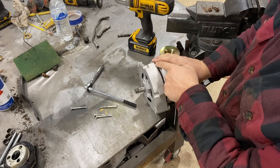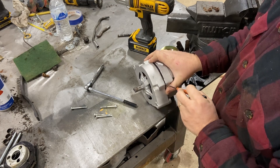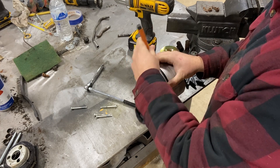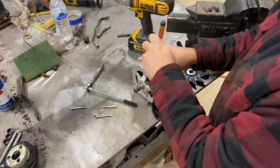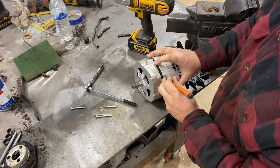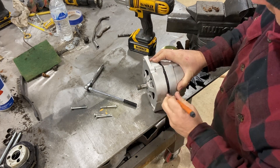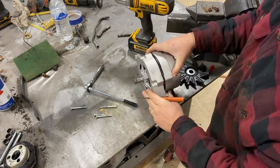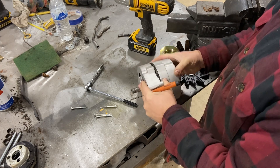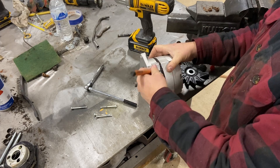So what you do is you take a screwdriver and the thin little black line that's in between — you want to pry on the front side of the black line. There's a little tab in here, get a hold of it, work your way around. You don't want to pry on the back side and separate it because it's actually soldered to the voltage regulator and the back of the alternator, so you don't want to break that one loose. Otherwise you're going to Napa and getting another alternator. And of course if you do this — I've already taken the stickers off, but most of them will put a sticker across this. If you peel that sticker off, they void the warranty. So follow me for more tips on how to void your warranty.